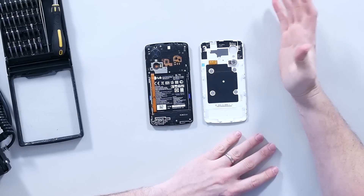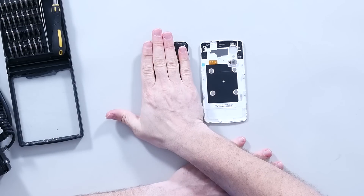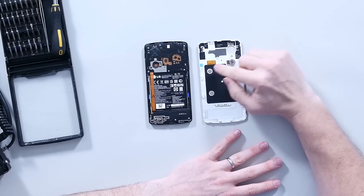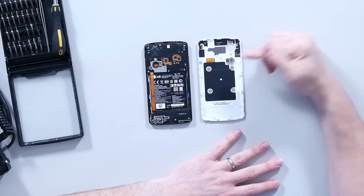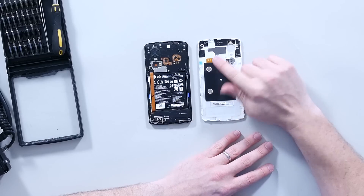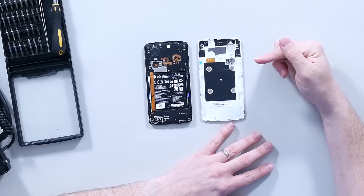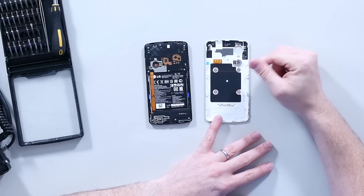Now we're in the back. You can see the main body of the phone with everything in it, and on the plastic back of the phone you've already got a handful of contacts. You've also got the vibration motor for feedback. What surprised me is just the number of antennas. Here you've got four contacts — they supply the NFC, or Near Field Communication — but you've also got two more there which do wireless charging. This was one of the first phones to come with wireless charging built in.